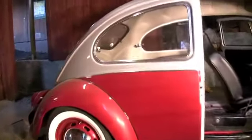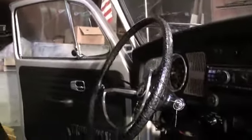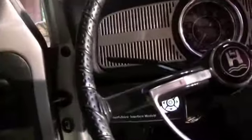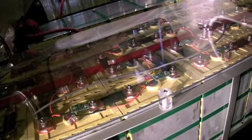Take a look at the inside, the interior. Over here on the left we have a Net Gain interface module hidden behind. Here is half the battery pack — the other half is in the front trunk. They are 3.2 volt Thunder Sky lithium iron phosphate batteries, 200 amp hours each, 48 of them.